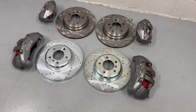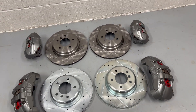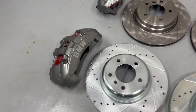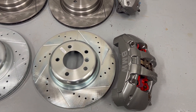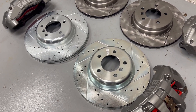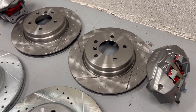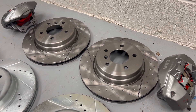Hey guys, just a quick overview on the brakes that are going to be going on my E91 wagon, my 2011 rear-wheel drive wagon. These are 135i calipers with EBC red stuff pads using OEM 135i sizing rotors — not OEM BMW manufactured rotors. The rears are also an aftermarket brand, Dynamic Friction, and I'll put a part number in the description.